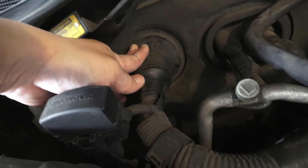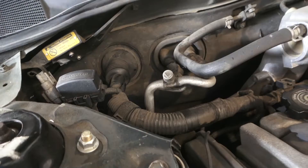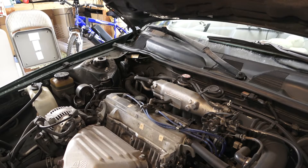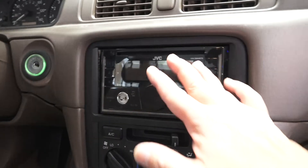I'm going to insert the power line right in there — I just need to open this part and insert it. The next step is to remove the glove box so I can see from behind the firewall when I insert the power line. On this vehicle there are screws and a 10-millimeter bolt to remove. Yours might be different, so look up videos specific to your vehicle for removing the glove compartment.